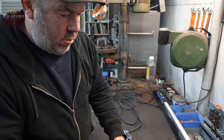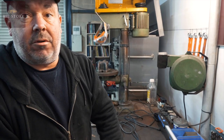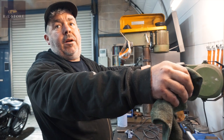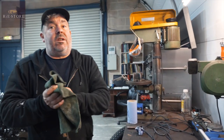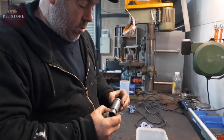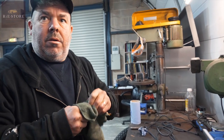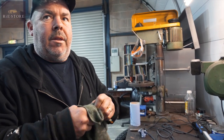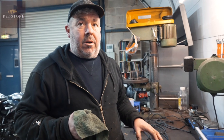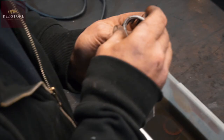How many different sizes of needle bearings are there? Loads and loads — plus one thou up to many more. The guys who do these all day long will have a rack from plus one to plus whatever. Unless you've got them all, all you can do is have a measure and a guess, really. Because these faces can wear as well, it's a combination of everything. There's no good looking in a parts manual for a size because with wear, you'd need a micrometer on everything to work it out precisely.